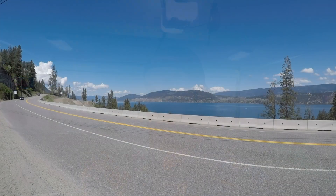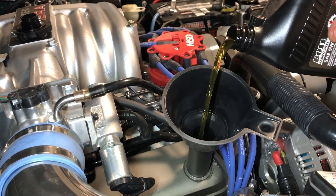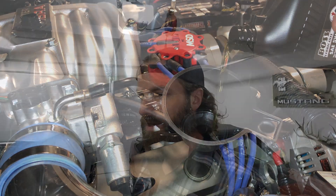If you are going to start your car during storage months, try to do it on a day where you can actually take it out for a drive, get it up to temperature, and clear as much of that moisture out as possible. That's really the only way it makes sense. Moisture is a killer. Since I can't drive mine once it starts snowing, I just don't start my cars. I'll take my chances with the dry start in the spring. If you're really worried about it, you can always pull the distributor out, spin the oil pump over, and get oil to the top of the motor before starting.